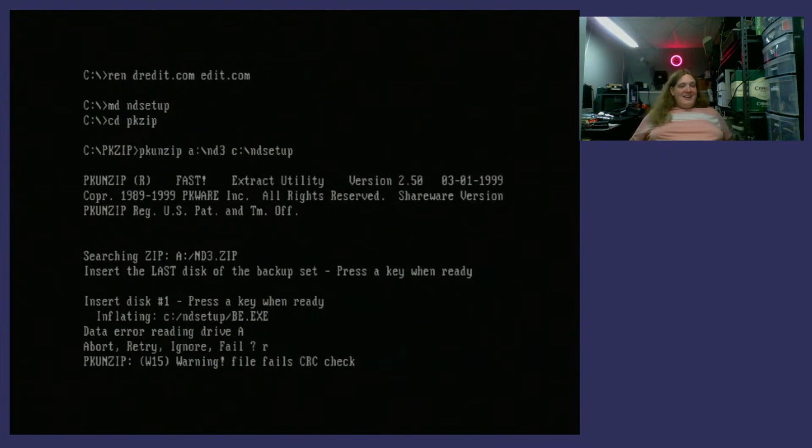This is where having an XT-CF card would come in handy. Just throw everything onto a CF and stick it in there. I've actually been considering buying one. Of course, I already have an XT IDE, and you can buy a CF adapter for an XT IDE, but I don't think you can get an expansion slot adapter so that you can externally pull out a card. The floppy drive's still doing something.